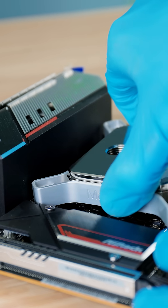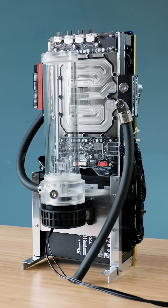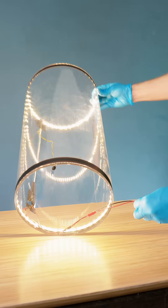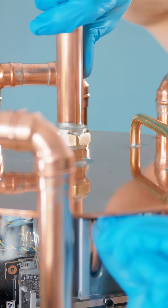For this to work, I need to install water blocks onto the parts and arrange them into a small form factor brick that can be lowered down into the cooling frame and plumbed into it. After filling it with coolant, an acrylic cylinder can be used to fit over the components, using rubber gaskets to make a watertight seal by clamping it together with bolts.